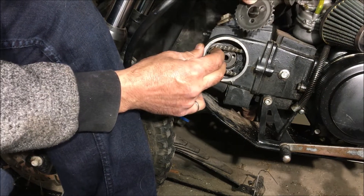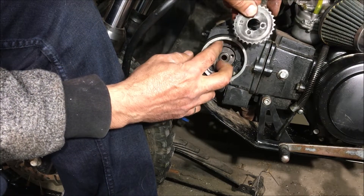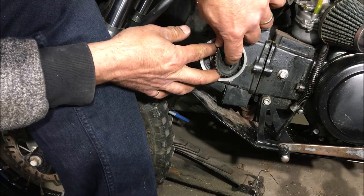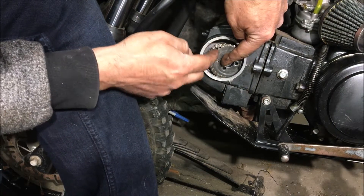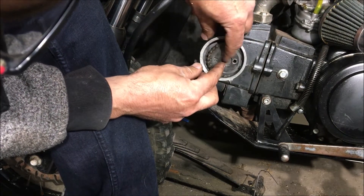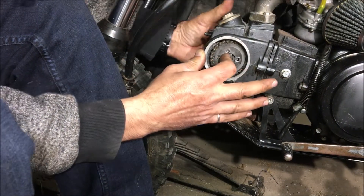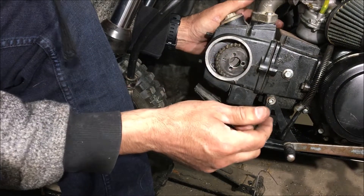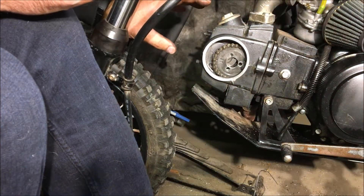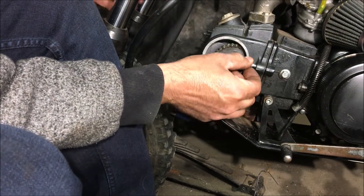There are no bolts holding it together yet, but I'm going to put in the sprocket. We'll slide it down and remember to line up that mark. Then rotate — there you go, pretty much it. We need to check how well it lined up. I'll leave it like that for now so it can't go anywhere. For this cover area we're going to use gasket material in a tube rather than making a gasket — once we clamp it down it'll tighten up.